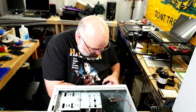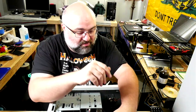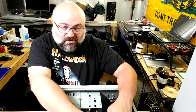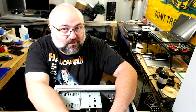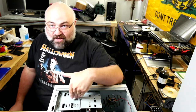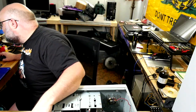My solution is I have my own Linux distribution — I don't really distribute it much. I can boot this old machine from a CD as long as it's got like 128 megs of RAM, run Linux, and use USB Ethernet or anything a modern Linux kernel supports. I can copy floppies, copy zip drive contents, whatever, and use USB mass storage — because Linux works on everything.